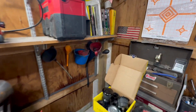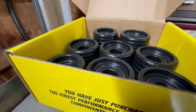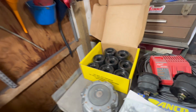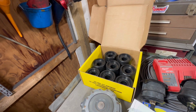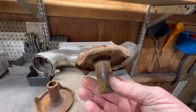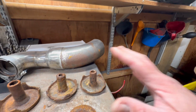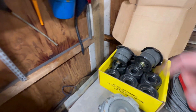Now, some of you who are eagle eyes are going to look at this and say, hey, wait, Rob, pause, and the energy kit will follow through with this. You can see, if you look, I don't know if the video shows, but these two back here are taller. They're a taller mount because the standard extended cab rear mounts are in fact taller. I don't know why, probably based on where they could put the mounts on the frame. But regardless, yes, they are. Yes, when I use these retainers, they're not going to go tall enough. I could theoretically weld some tube and make that work. We'll cross that bridge when we get there. But regardless, yes, I am aware that the other 6 are the same, and then those 2 are different.